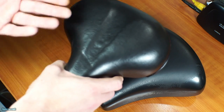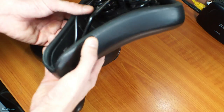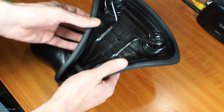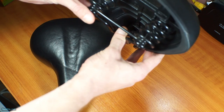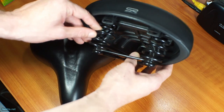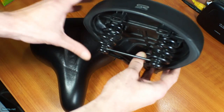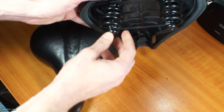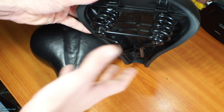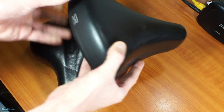That was my suggestion and that is what we did. The next bicycle seat is a more classical bicycle seat. It looks quite clean and nice, but there's a problem with it, and it is very simple: one of the springs is completely broken. Metal fatigue. You can very simply see that it is completely busted through. So even if this is a nice seat, it is completely busted and has to be replaced.